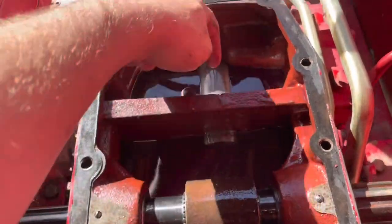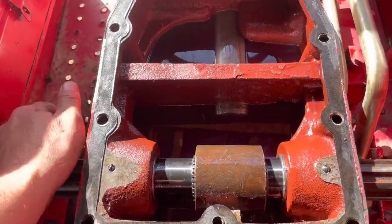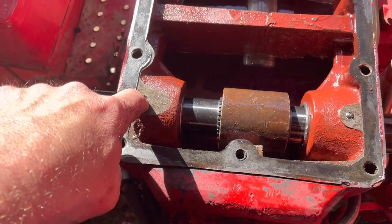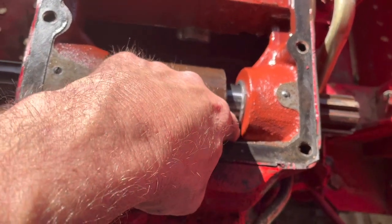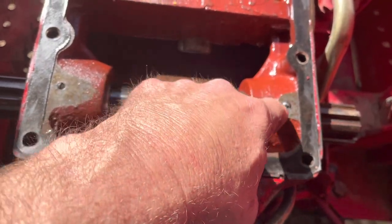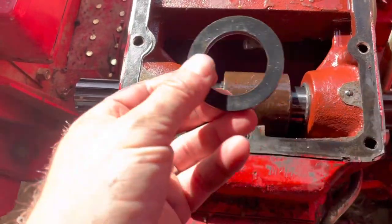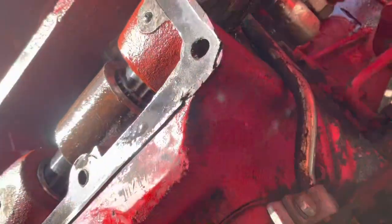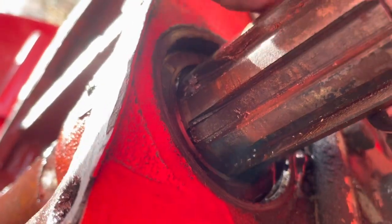This collar here — there's a rod that goes in there, and the cylinder inside has a piston that pushes that out, and that's what raises your lift. I drove this bushing back in place, and I probably won't have to take this one back out. On this side the bushing's cracked, but I forced it in there the best I could and locked it down as tight as I could. I need to order this bushing and a seal on this side, and maybe these little hard plastic washers — this one came off this side. There's a seal that wore out from having the bushings slid out like that, so it's going to leak oil still, but it won't have that play and wear anymore in the meantime.